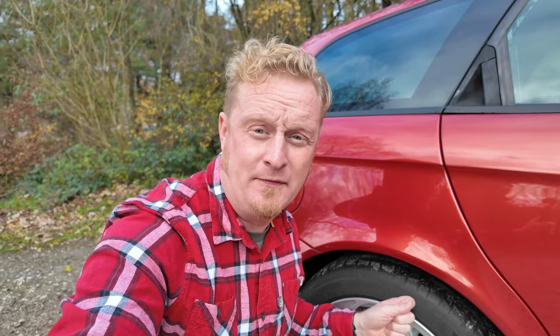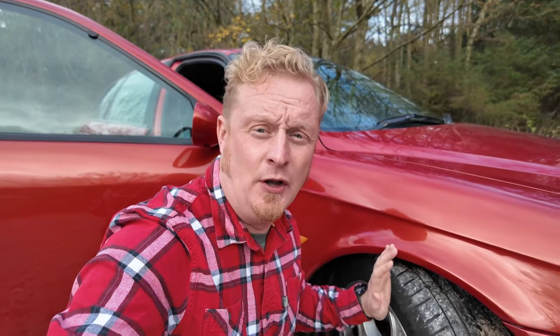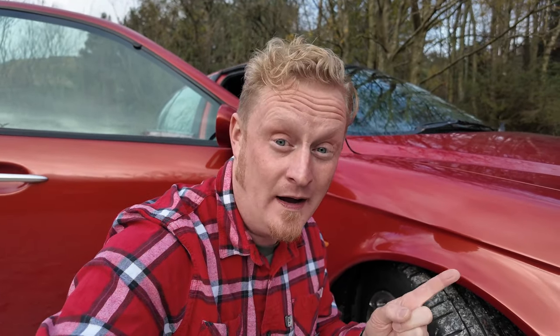Something that was surprising was the tire condition. The tires look great and haven't really done many miles — they were replaced just before I bought this car. These Michelins look really good and feel great on the road, but according to the MOT they are wearing on the inner edge and a few have got cuts and slashes. They're not dangerous at this time, but it does beg the question of when and what I'll replace them with. This car has been lowered, which probably accounts for the inner edge wear, and I've got Bilstein coilover suspension. I find it pretty overdamped — it can feel a little uncomfortable on some bumps and in compressions. I'm wondering if it's time to replace it with a more modern coilover system, which should also improve handling, lose some weight, and fix that tire wear.